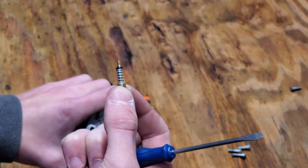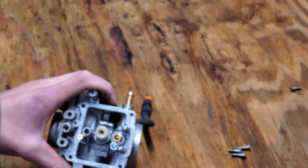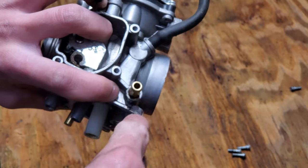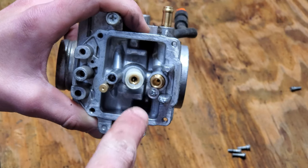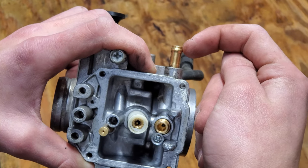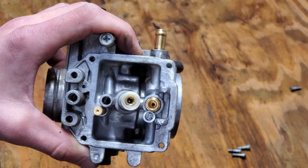You can see the assembly for the adjustment screw — there's a spring and then a little o-ring in there as well, so make sure all of those come out before you spray carb cleaner through there. Once we have all those out I'm going to take this outside and spray carb cleaner through all these passages. This is where the fuel comes in — it goes right through there. I'm actually going to blow the carb cleaner in through this side because there's a screen in there, so everything should be trapped on the other side. If you spray through the other side it's just going to get caught in the screen — you don't want that. If you really want to, you can also take out this screw and clean out the screen.